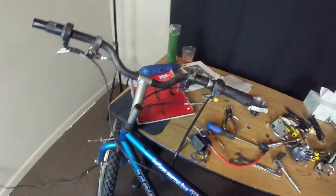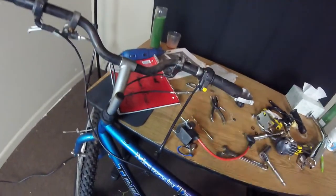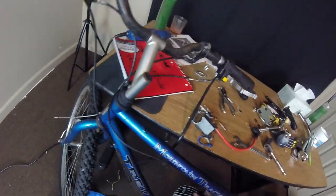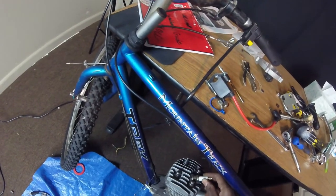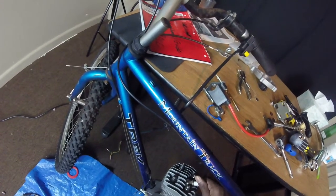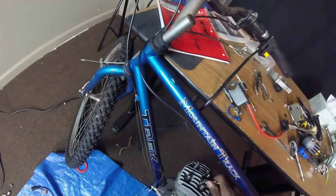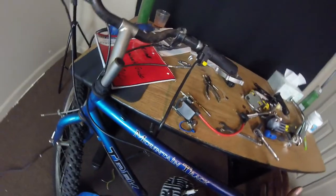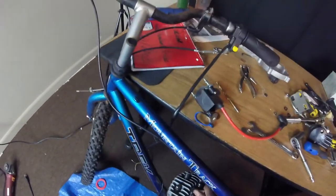This is the spark plug tool right here. You don't want to put it in there first and then try to tighten it down real hard, because you might cross thread it. And I've seen a lot of people who did it. You want to do it by hand, wiggle it in there, make it flat, and twist. Twist it by hand, it should be easy. It shouldn't be hard. If it's hard, that means you cross threaded it and it's not right. You need to back it back out and tighten it back in.